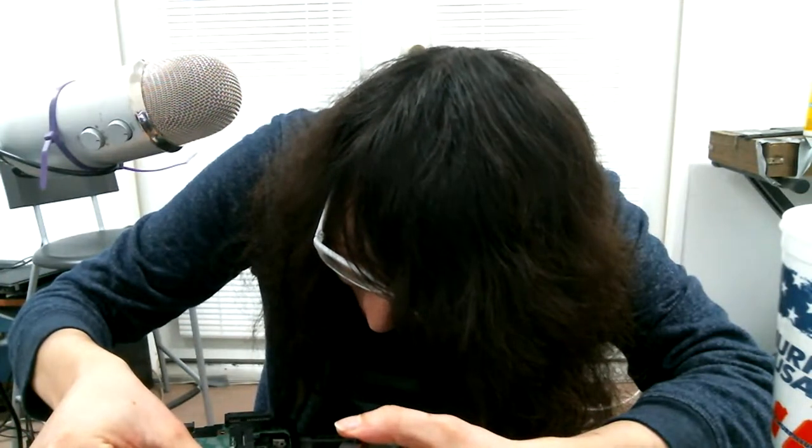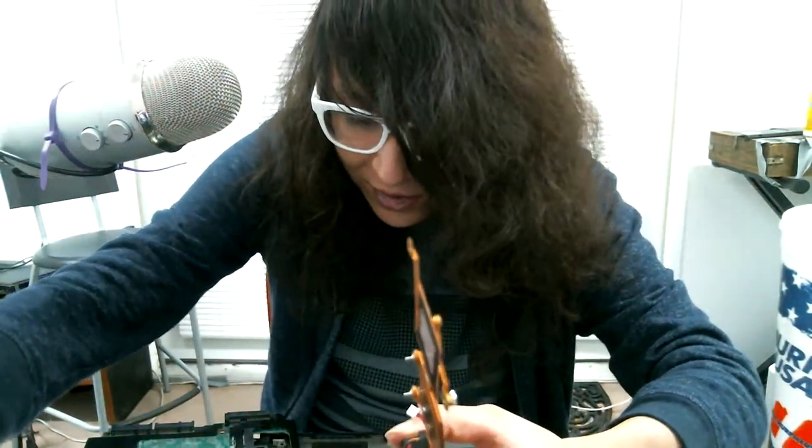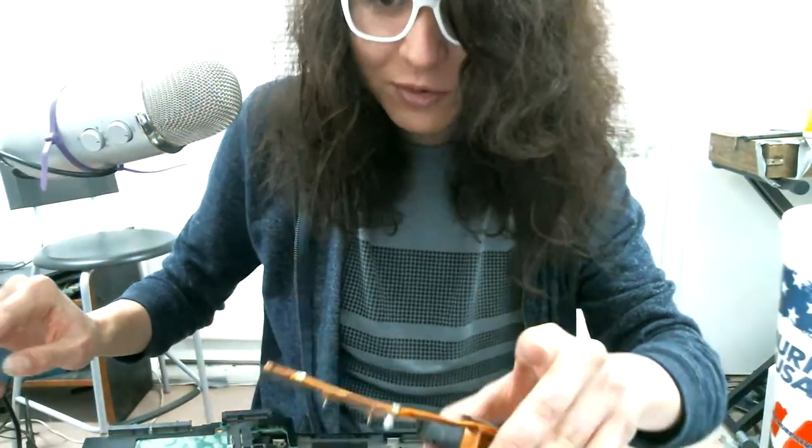Unfortunately, because the systems are older, I get really obsessive about the thermal paste, and I'm still trying to make it as smooth as humanly possible without special equipment. At some point you have to wonder if it's even worth doing this or just putting the little drop in the middle. The point of it is to fill in the little crevices in the metal and make the contact better, and I did notice some thermal improvements this way. Not by a huge margin, but maybe a degree Celsius or two. But okay, if I spend any more time on this, I'm just going to feel like an idiot.